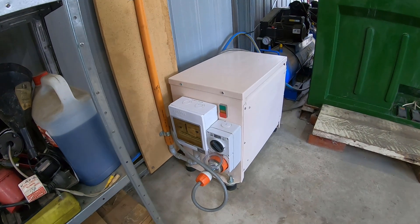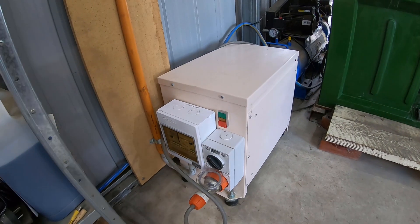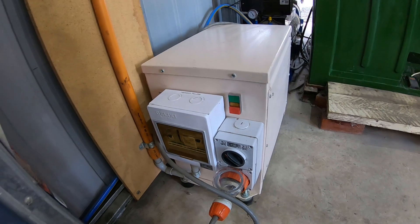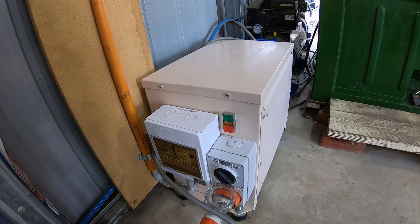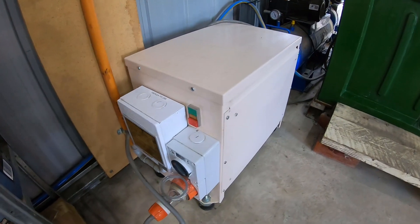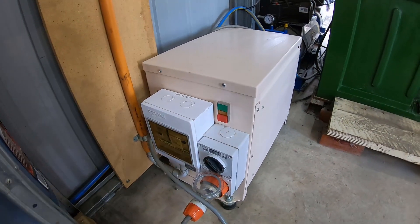I just mentioned that that pump was three-phase. I don't have three-phase in the workshop, so I went to a place in Melbourne and they built me this phase changer. I get single-phase in, three-phase out, and my machine works a treat with this.